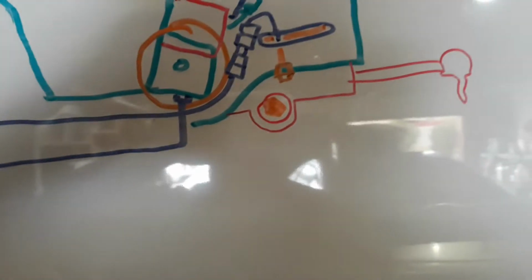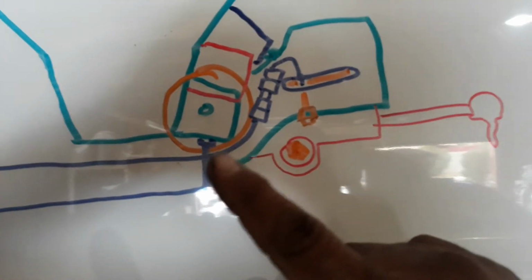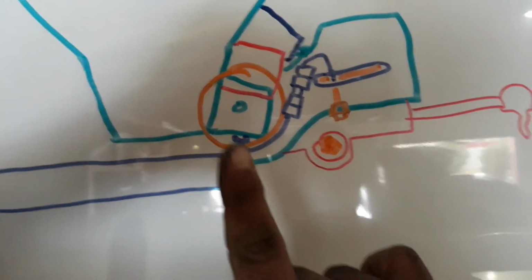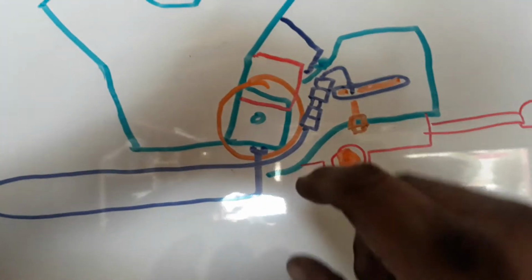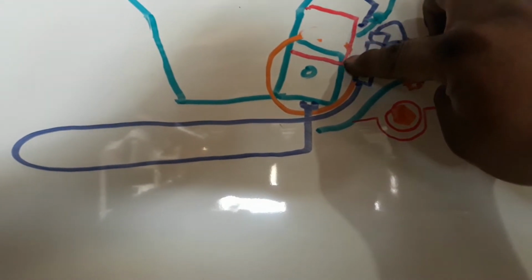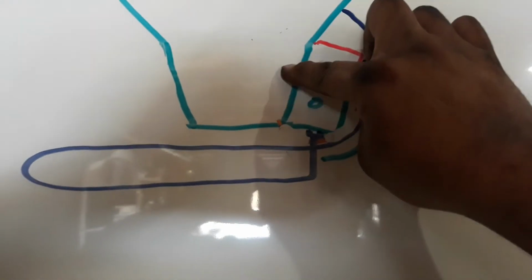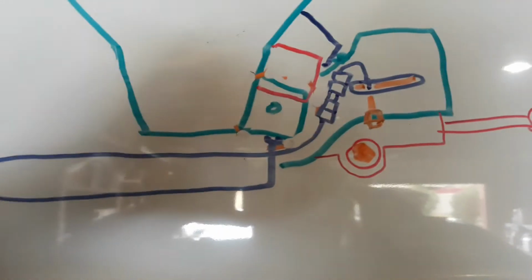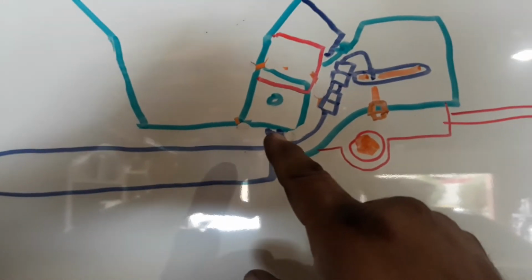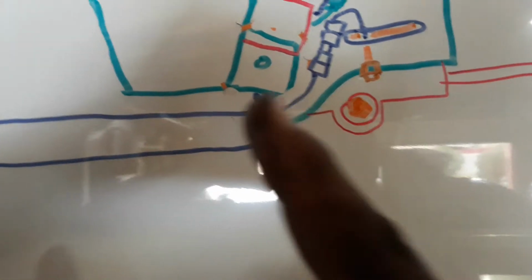And so the way this line is set up, this is the power steering. It's plugged into the bottom of the power steering, but so close to the pulley that the pulley has to be removed. So we had to take off the pulley. So once we removed the pulley, we had access to the nut to be able to unscrew it and get the line off.